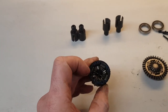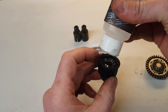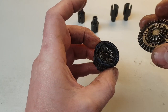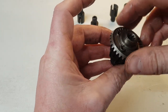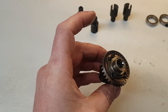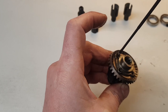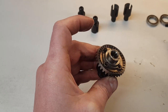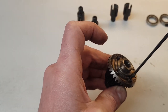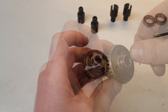With the pins now correctly installed, you need to decide how much oil to put in. From my experience, I put enough in to just cover the cross pins. Now back to the ring gear — there's no need to use thread lock on these screws because you're going into plastic. You only need thread lock when screwing into metal, because then there's a chance it could come undone. With the rear diff, the ring gear screws into metal parts, so you need thread lock there — but not on the front.